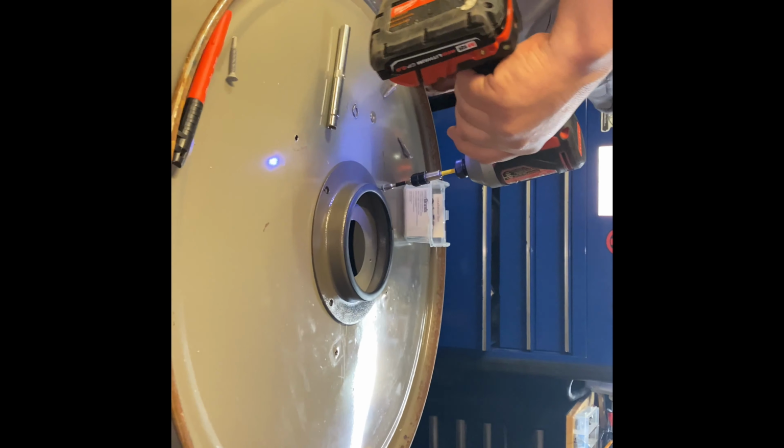So as you can see, let me take off one bolt. Got this good size bolt. It's gonna fit right here, and it fits perfect in there. And I didn't really have to modify it too much. Basically what I did, I put these a little bit tighter so they fit kind of upwards and I can just slide it right in. I did use this bit right here. See what size it is, just so y'all know. It says DeWalt 3/8. So I did a 3/8 hole here and here, and that way I can use those bolts.